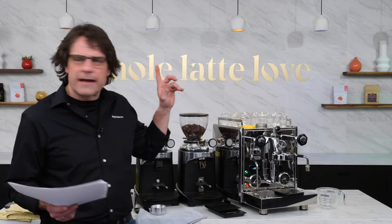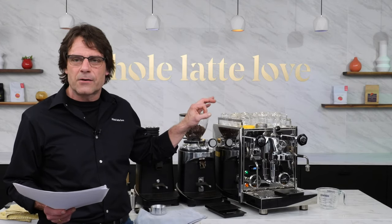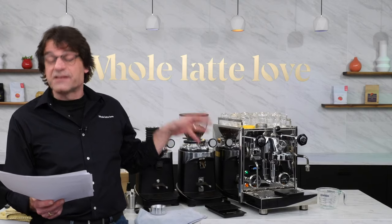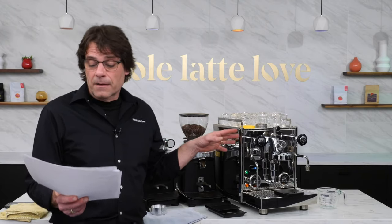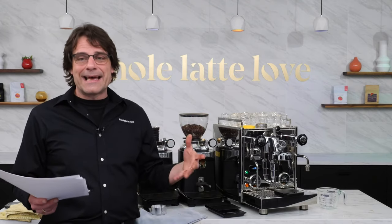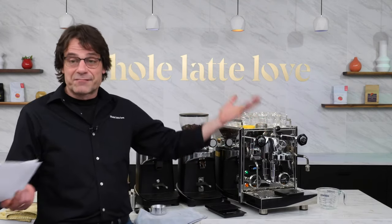And I used a Pro 500, I think, the other day for my dialing in video. That is a vibration pump machine, and the stock flow rate out of that is about 7.8 grams per second. And we're going to go through and show you how to measure that. So let's go do that.